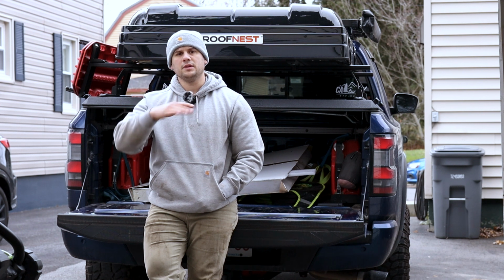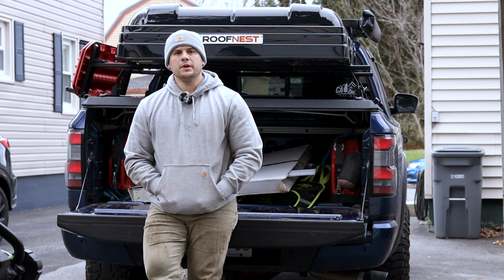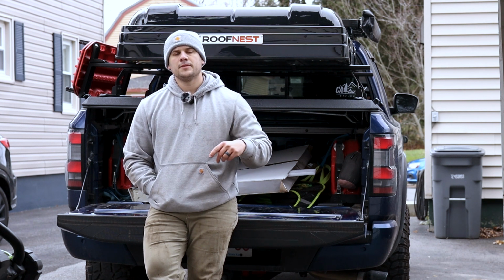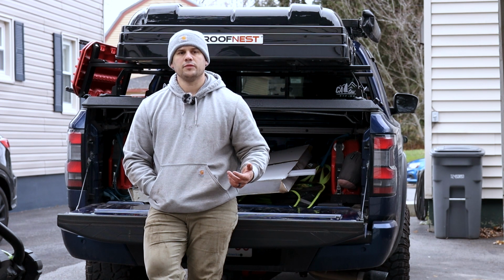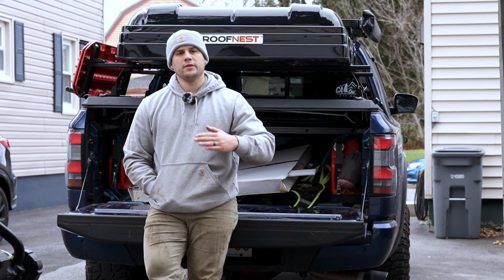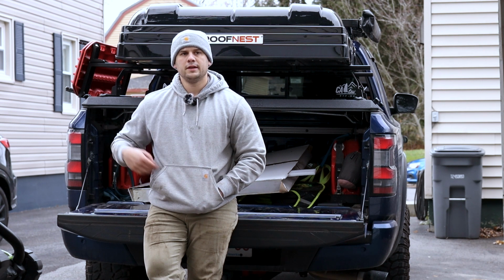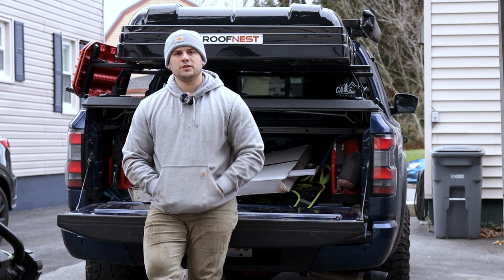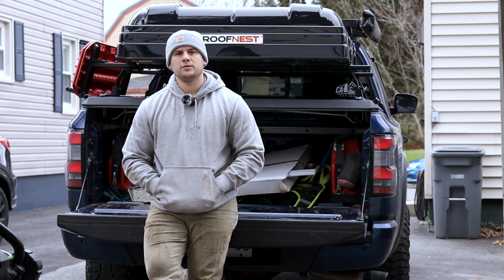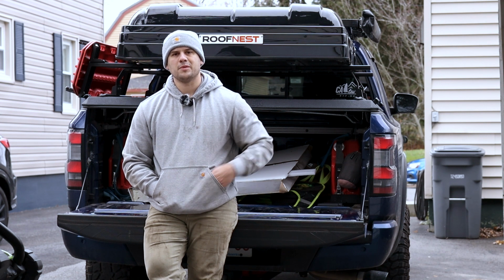It's just kind of like a piece of steel sheet that's, I don't know, kind of skimpy, but I'm not too worried about the transfer case as much as I am the actual transmission pan, because as you guys know, we have 3rd gen Frontiers, possibly previous generations. I'm not sure if that carries over from previous ones, but with the 3rd gens, I noticed there's nothing there. It's just a big open void for stuff to smash into that transmission pan, which is fully exposed, and it's not tucked up very far from the actual crossmember and frame.